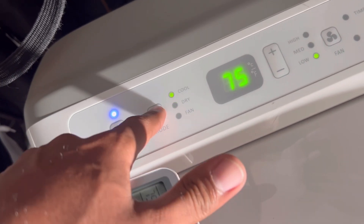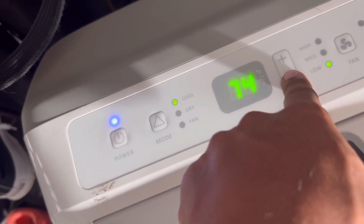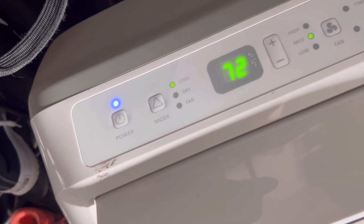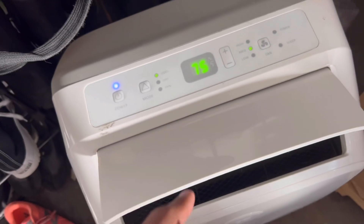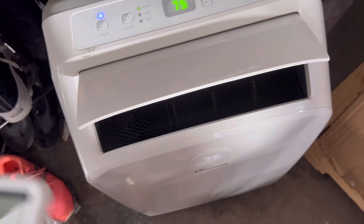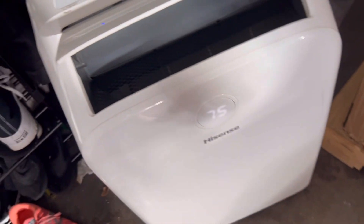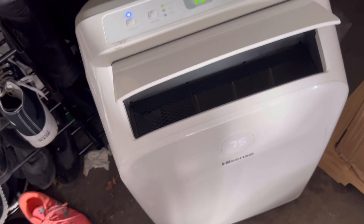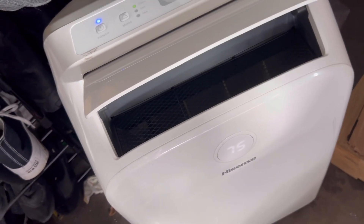If I put it on cool, then you can control the thermostat. So if I set it to 72, it actually detects when the ambient temperature drops below 72 and this fan will automatically cycle, kind of like a central air conditioner unit does. You guys can feel it blowing very nice cold air out of this unit, as this unit has good refrigerant, and the blower motors are all working really well.